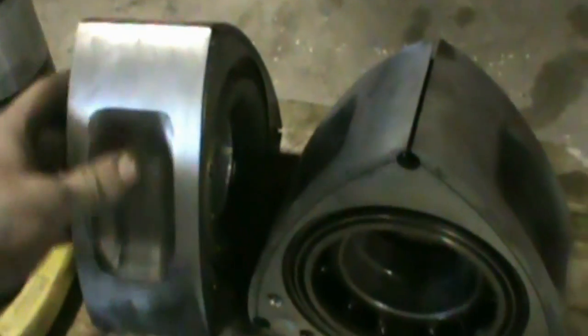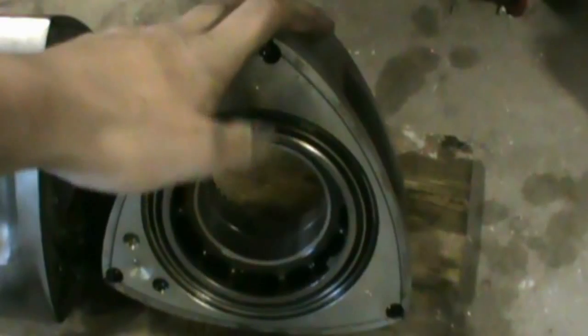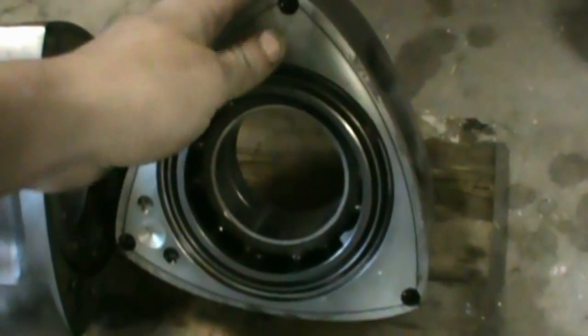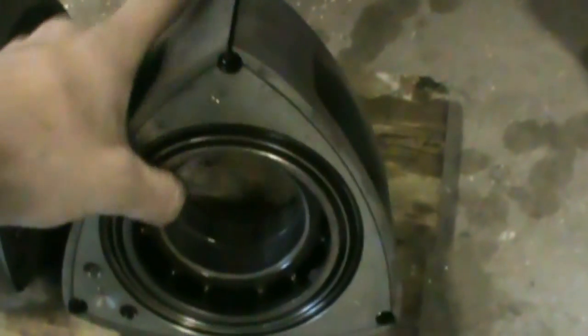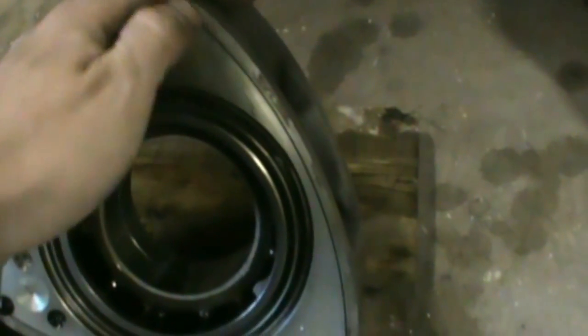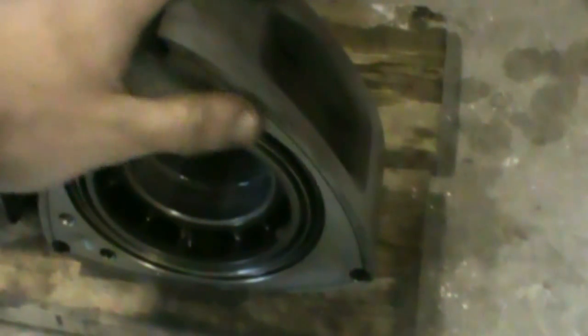Yeah, so I got the rotors pretty clean — most of the carbon off them. I'm going to have to let them soak a bit more to break up the carbon, because you have to go around every little groove and scrape out all the carbon so all the seals clearance right. Right here you can see that rough stuff still on there — that's the soft metal coating they put on at the factory. It's not important if you keep it or not, there's no ill effects if it's not there. Pretty much I just get a scrubby pad and scrub it down smooth.